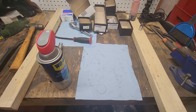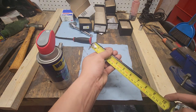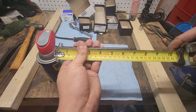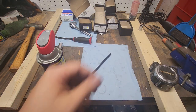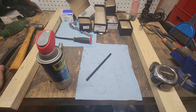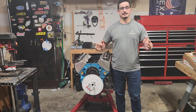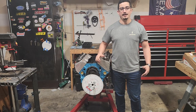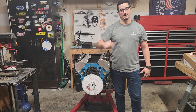Now that we have a good pattern on our valve tip, we're going to measure our pushrod as accurately as we possibly can. Just measure this guy — that's coming to just about a seven-inch pushrod. Cool. Now we know what length we need and we can order them up. At this point of the build, that's kind of where you're at — you can't go much farther without the pushrods. You can't assemble the valve train, can't set anything, can't torque the rocker arm studs down. You need the pushrods to continue. All right guys, that's going to do it for now. We're at a great point in this build. I hope you picked up a tip or a trick along the way. Don't forget: you don't need to be a professional engine builder to build your own power plant. Like and subscribe, and as I always say, don't be afraid to dive in on your next project. See you next time.